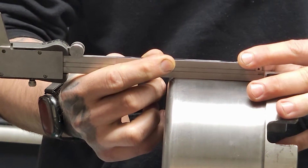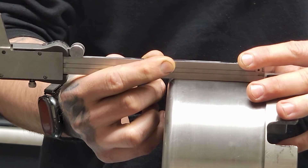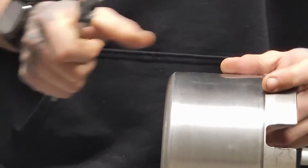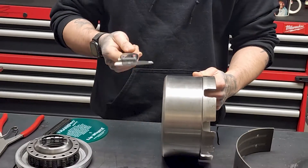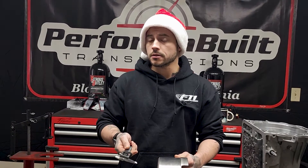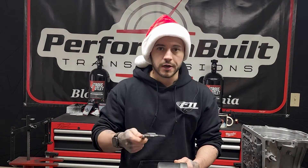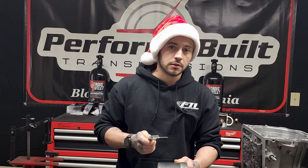It's a great idea to make sure it's very flat when using an OEM band as well. You should not be able to see light — it should be very flush. Try not to get up against the weld; nothing rides there. It is okay to get your drum machined with just a few thousandths off. One to three thousandths is going to equate to a whole lot in the circumference of the drum. So you can't cut five off, you can't cut ten off, but you certainly can resurface these to a degree.